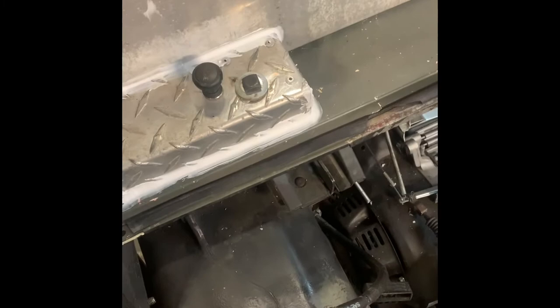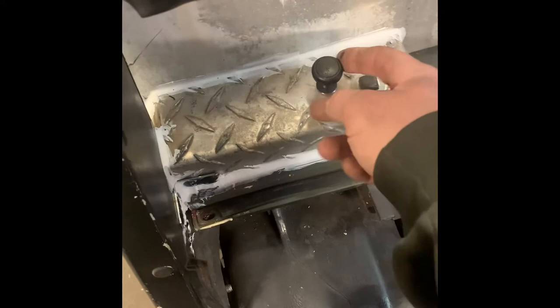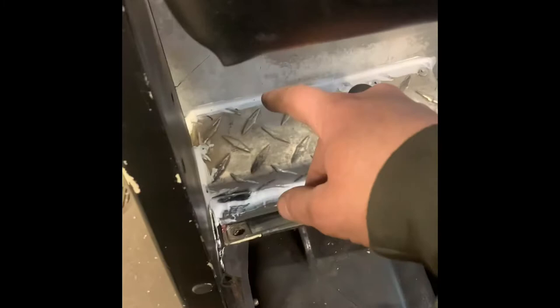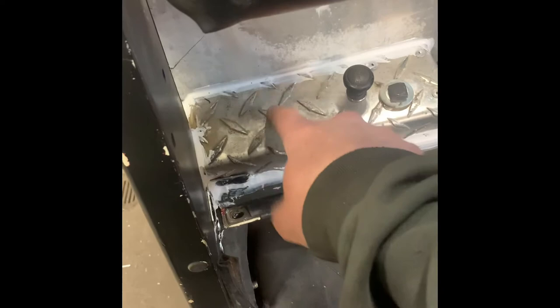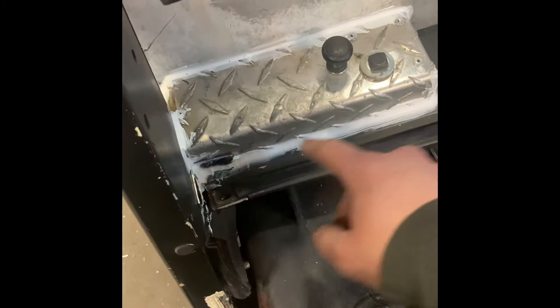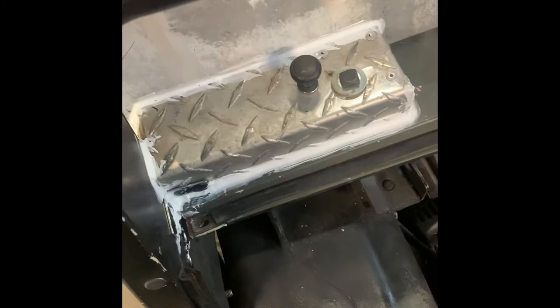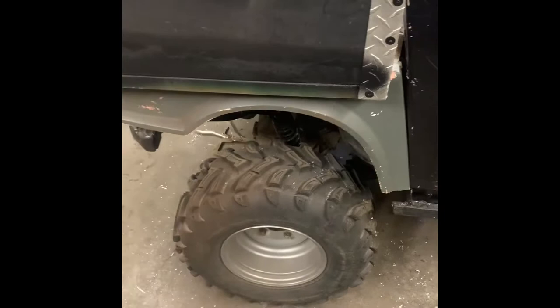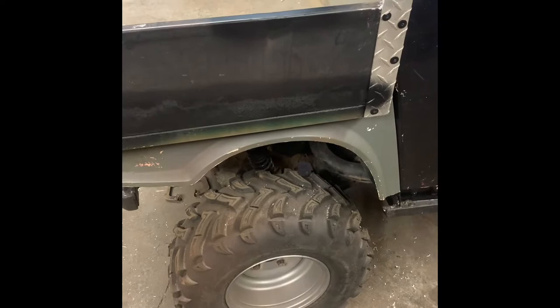So my problem I was having before with this is when I'd pull on it, of course, the plastic was flexing real bad. Well, now it doesn't. It's solid. Another issue we were having is the mud was coming up through the fuel door. So I just threw some body caulk here to hopefully keep it from spraying mud all over the passenger. I put another mount here for this cover. Sprayed some rust inhibitor on the rusty steel there and painted the box all black.